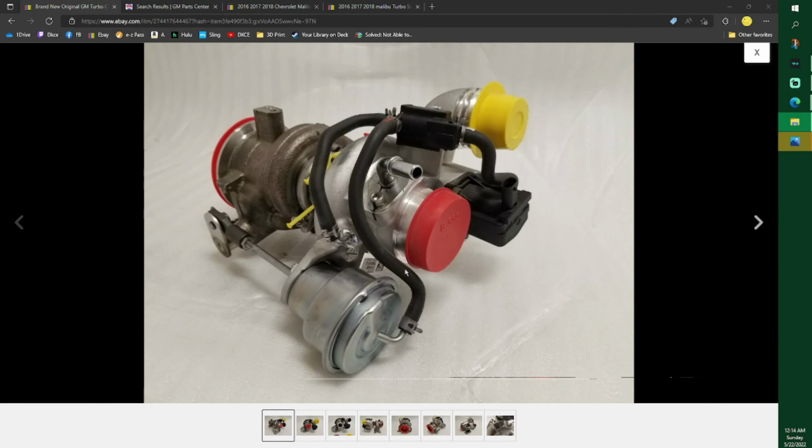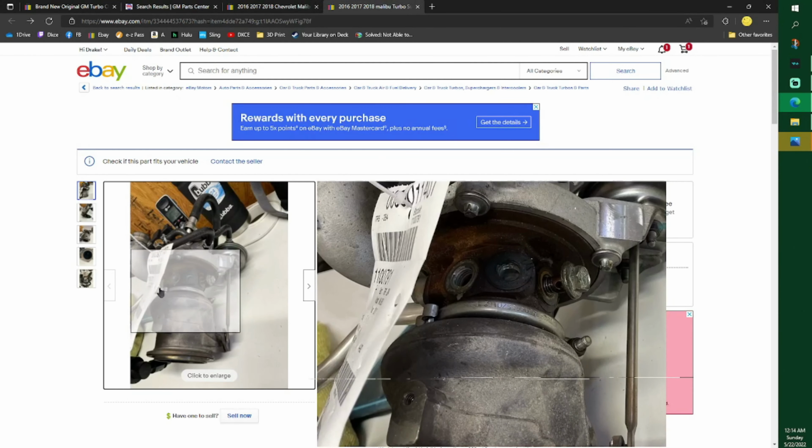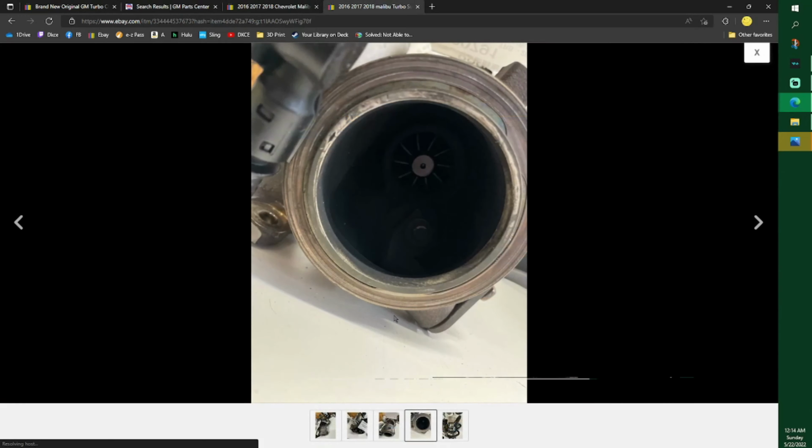So let's go over this, make sure I didn't do anything before I show you the end result. On these, you're going to want to look for oil because these hold oil and coolant. Just make sure there's nothing too bad in here. I got this one out for purposes because on these turbos, they like to crack right in here. I was actually talking to someone and they're like, "Well, look for the crack." I guess it cracks on this side. I know it's in this area. Mine wasn't cracked. I got 3 turbos so far, and none of them are cracked.